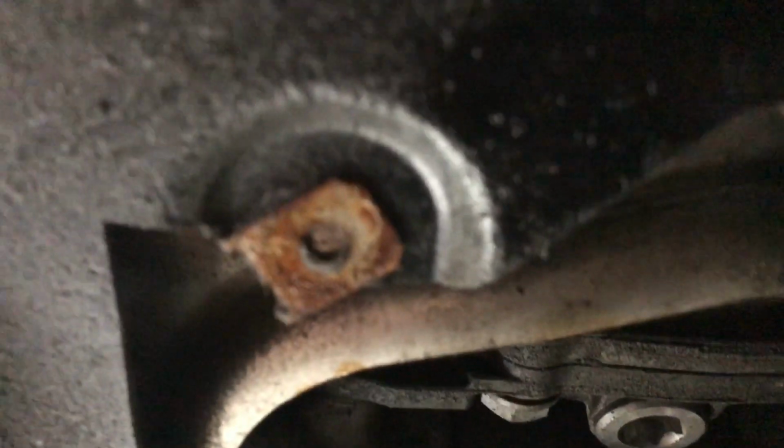So now, this is the tricky part, putting the cover back on, because the bolts come all the way out. So I always try to just get the one closest to me. I'll put it through the cover first, like that. That way I can line it up with this close one and just thread it with your fingers. Once you get that on there a little bit, the cover will kind of hang down, and then I'll do this other one across from it, since you can see where it needs to go there as well.